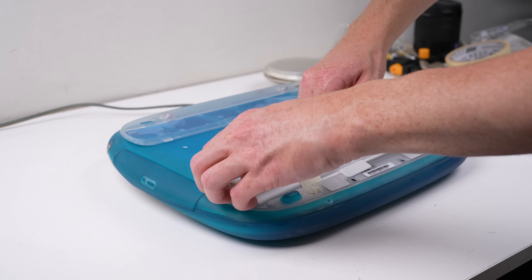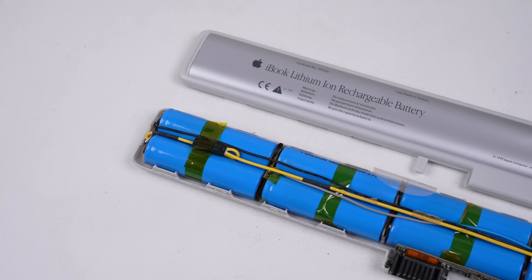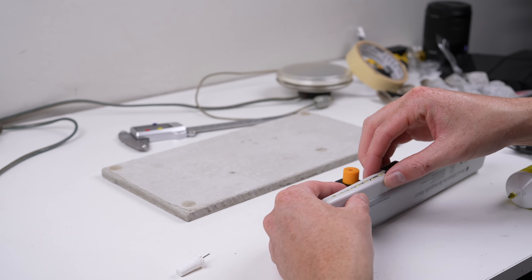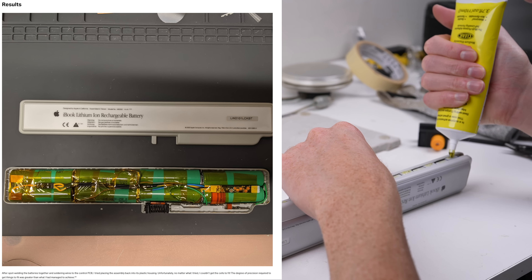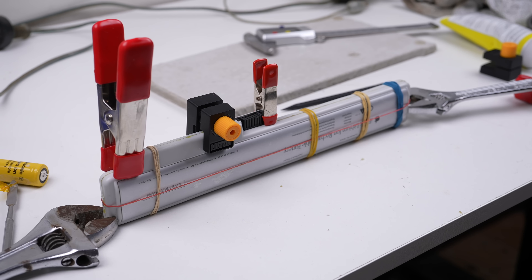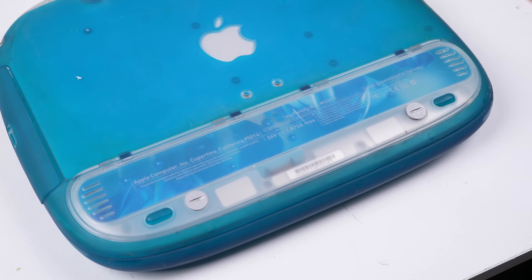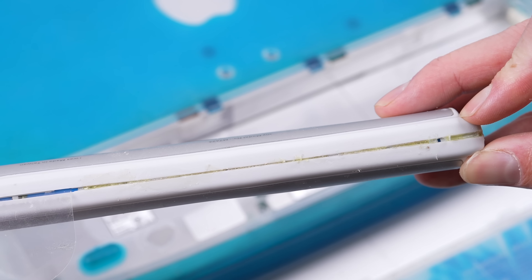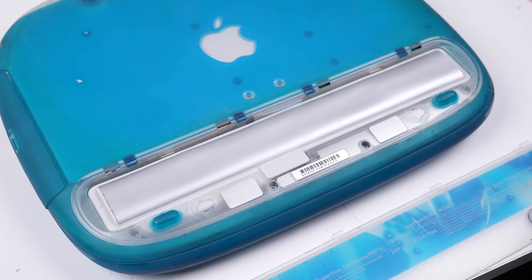Before it charges fully, I wanted to properly glue it together — so it's out with the battery and time to bust out some glue and clamps. The original cells were definitely smaller than the standard 18650 battery, so the new ones sit slightly higher and prevent the case from closing properly. It appears I'm not the only one who faced this issue when rebuilding an iBook battery. Busting out everything I could remotely clamp with, I managed to get it to an acceptable state — not perfect, but given the tight tolerances, it's a win.